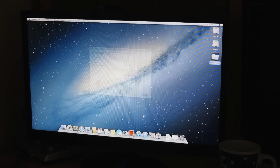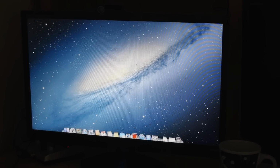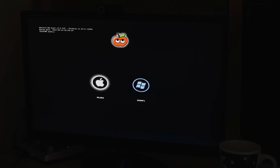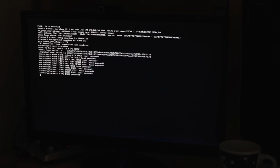So if I just now hit close, I'm going to pull, the memory stick's already gone. Let's do a restart. I will show you a little tip what you can do when it's restarted. I should have done it then, so it always boots up in verbose mode, but I'll manually override it. So this time now, you'll see how quick UEFI BIOS is now, by the way. Look at it, it's already loading. I'm just going to interrupt it and put /V in, so I can see what's going on.